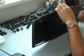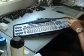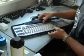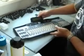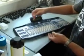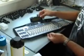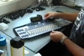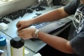If you are going to use something, it's a good idea to make sure that it's not going to cut the product at all. Sometimes you might find it does stick a little bit. Now when you get round to the back, I recommend you flip the LCD screen out, because there's a cable that connects the LCD screen to the main PCB assembly inside the keyboard. By flipping it out, you give yourself a little bit of extra slack to work with, just so you don't damage anything. So we get round in here.